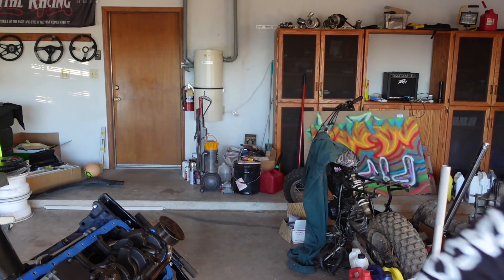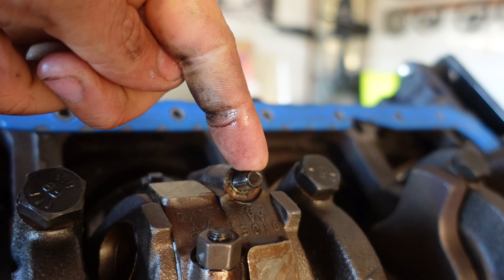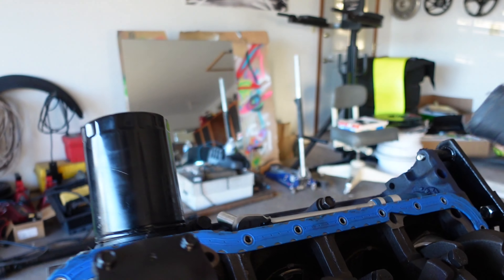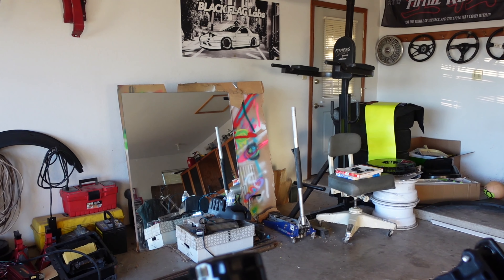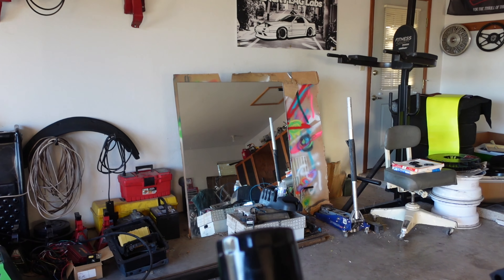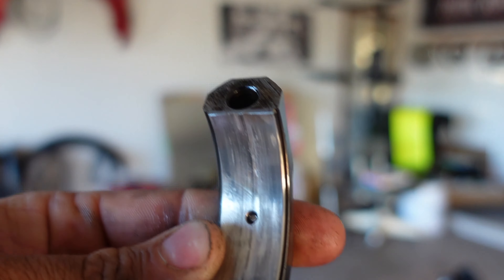He's got the nuts off — because these have nuts on them, not bolts. High horsepower rods will have ARP bolts that go into them. And there it is — and there's the bearing. It's a little toasty. This bearing, as you can see, is chewed up. It's got a little groove in it.